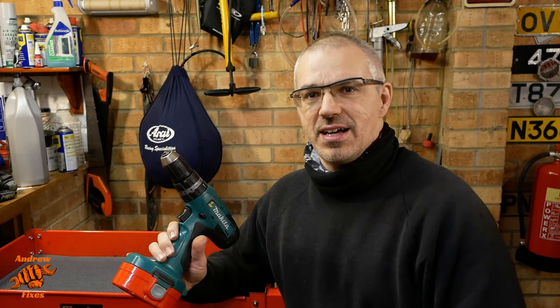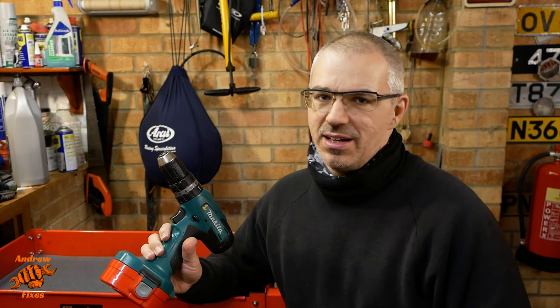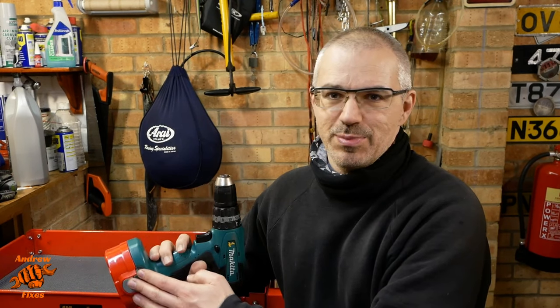Anyway, it's on its second set of batteries. These are a cheapo copy and as you'll have seen from that bit of video, it just dies. If you've got one of these, I'm sure it's a familiar tale. This battery, when it's straight off the charger, will do about three of those screws before it's had it. There are various options for dealing with these nickel cadmium or nickel metal hydride batteries — zapping them with a higher voltage, linking two good 18 volt cells in series and shorting them across the battery can extend the life a little bit. But these batteries are rubbish. I'm not really interested in extending their life any longer. They need to go and we need a different option.